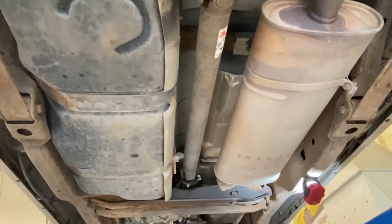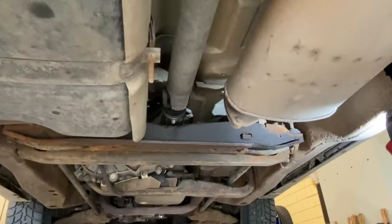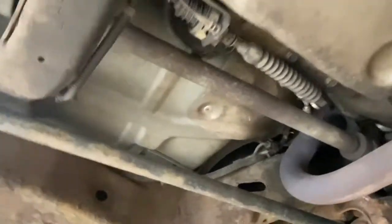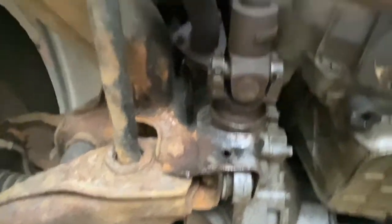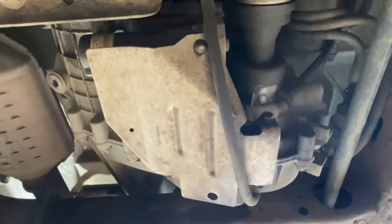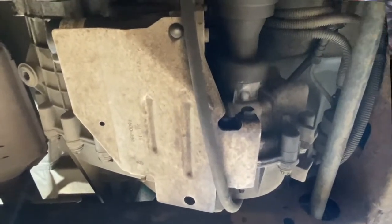You can see under here the drive shaft on this specific vehicle — a four-wheel drive GMC Jimmy — traveling down, with the front slip yoke assembly going into the automatic transmission. There's also a smaller drive shaft under this vehicle driving the front differential assembly, and it goes to the transfer case in the middle of the vehicle just behind the transmission. A transfer case really is a type of transmission that allows the propeller shaft to be turned both to the front differential and the rear.